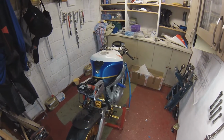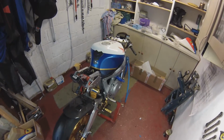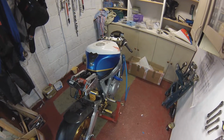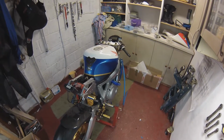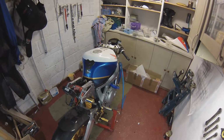I think that's why it boiled over initially at 100 degrees when it just had water in there, when it shouldn't have done in a pressurised system. And this Evans coolant runs under zero pressure. You can fully run the bike hot without even a radiator cap on. So it shouldn't pressurise at all and force fluid down to the reservoir bottle.